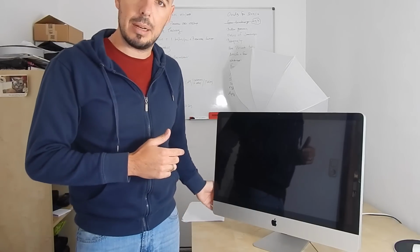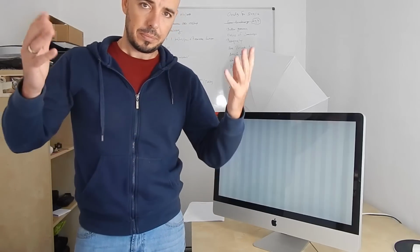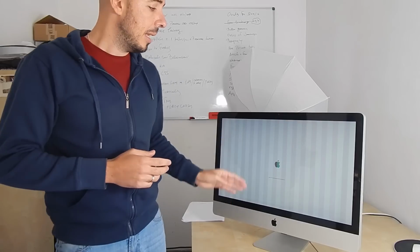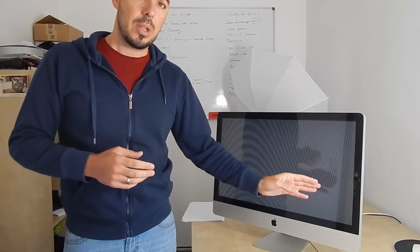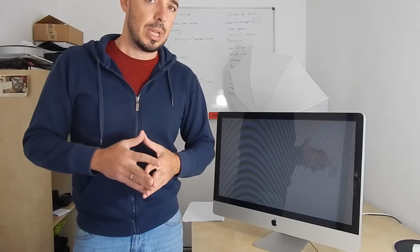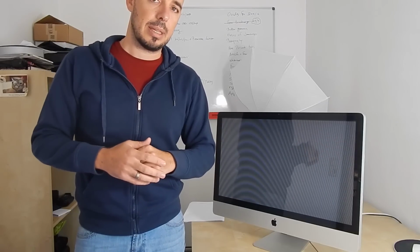So I will just turn my iMac on, and after the beep you will see this problem. These lines, afterwards they will become a black screen and white lines. It's a classic problem of the graphics card. You see that? So I will try to fix this. I have already done this once 2 years ago, and hopefully we will do it again together this time. So in the next video I will show you all my tools, and of course we will start opening the iMac case and then put the graphics card inside the oven.